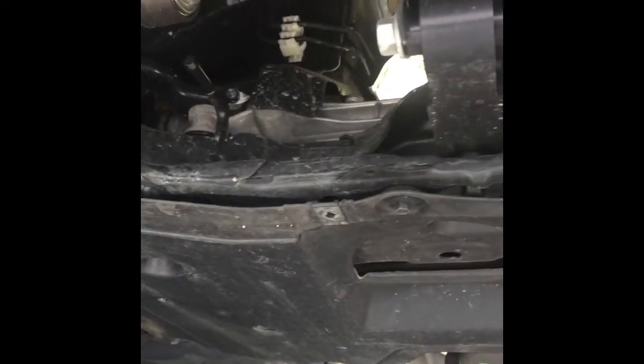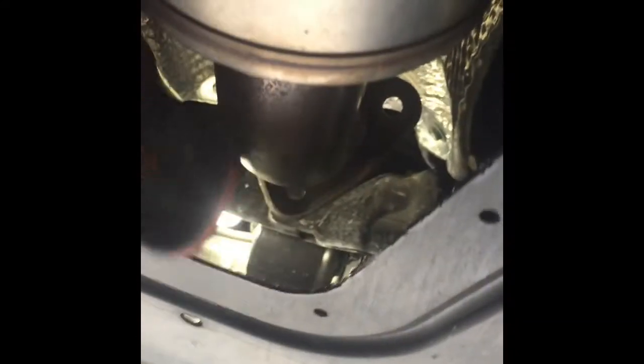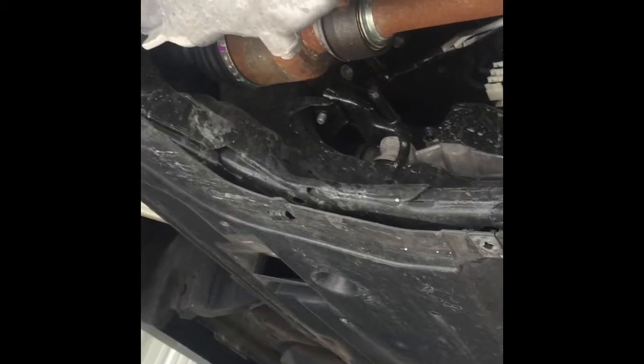Basically I pulled it out this cavity towards the front of the car. You sort of have to twist, and then come in the back here. Usually stick your hands or pry bar up in there, massage the heat shielding in there until you get the triangle flange to work through the space there, and sure enough, it'll come out. Installation is just the reverse of the removal. Turn it sideways a little bit, start feeding it up through, she'll go over, reinstall the hanger.